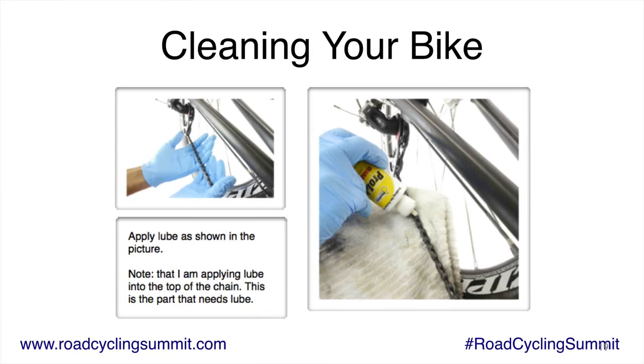Now, here's the part where everybody skips. Once you lube it, you've got to wipe it off. So lube the chain, get all the way around, and then take your rag and just grab it. That's when you have your rubber gloves, you have a rag, you grab the chain in your hand with the rag, and you just kind of rub it back and forth and keep going until there's hardly anything on the outside of the chain. It should look fairly dry. And it's a good way to clean the chain too. You're sort of cleaning and lubing in one process.